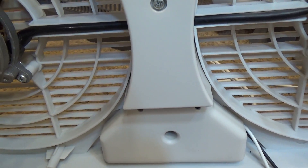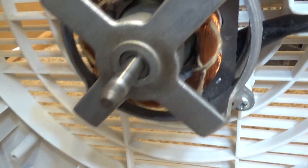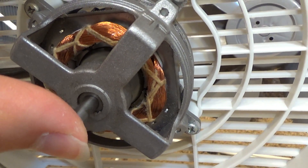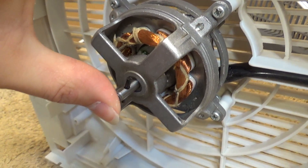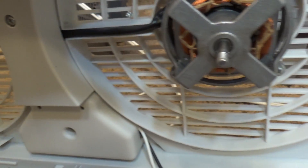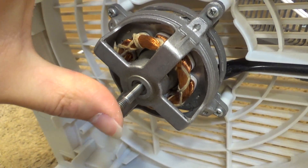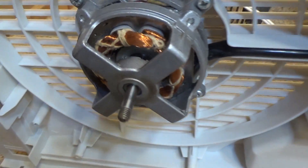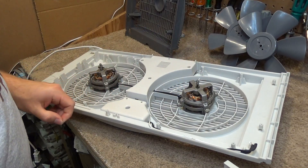Testing on high and then on low — yeah, this one is definitely much stronger than that one. It doesn't take much at all to stall this one. So there's definitely something not right about that motor. The bearings are definitely not as free in this fan, but they're not really stiff. It almost seems like it may be a capacitor issue.